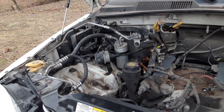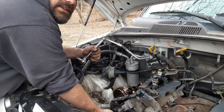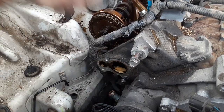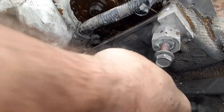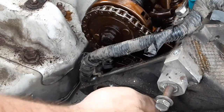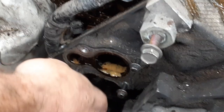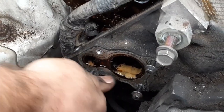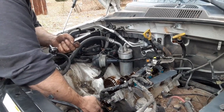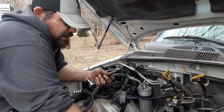How many tools does a man need to make it in life? Let me put my bolts back because I don't want to lose these. If you have a memory problem you might want to start labeling things at this point. In the old days the V8s — the bell housing bolts, everything — you could tell what was what. The starter bolts were different from the bell housing bolts. This thing has 15mm all over the front and 10mm everywhere else, which is nice — you don't have to change tools constantly.